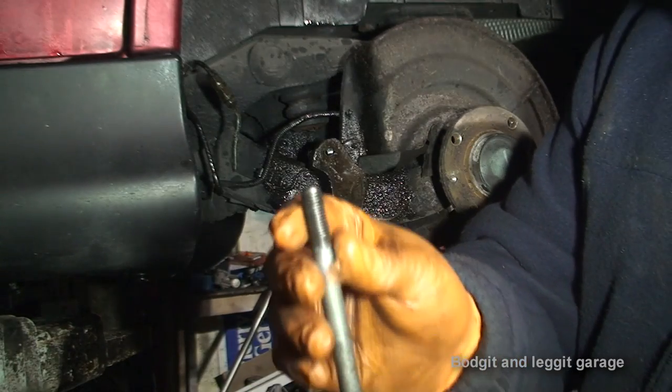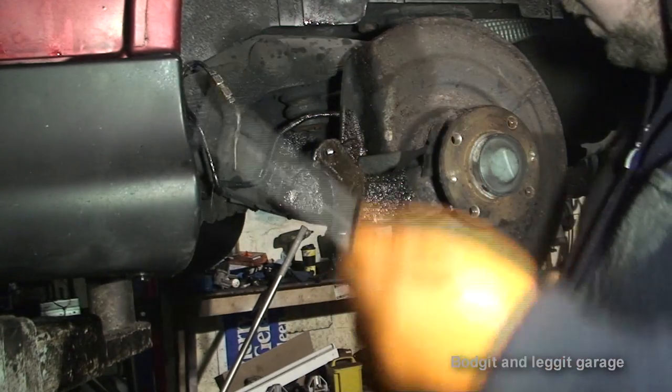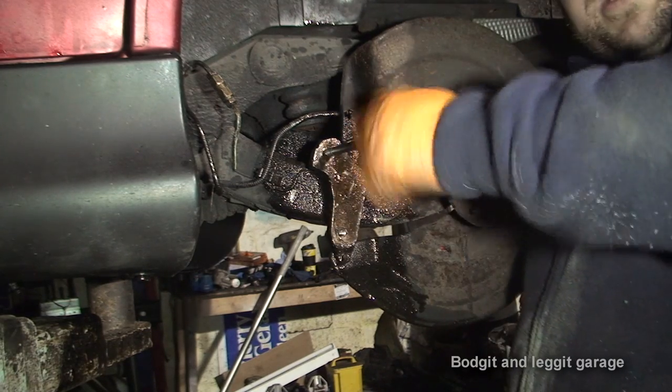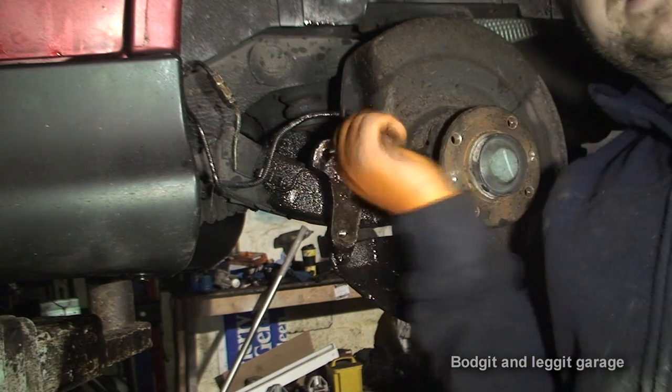You have to be very careful to make sure you're starting the tap straight — you don't want to start at an angle because otherwise you'll cross-thread everything and destroy it. This bottom one actually seems worse than the top one. Now all the way through to the end. This is the most important part — that these threads are okay. Worst case scenario you can always get bolts, but if you start damaging these threads you're in serious trouble because it's all part of the axle.